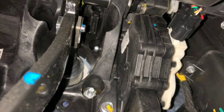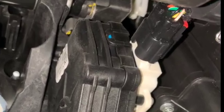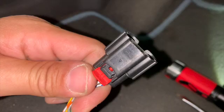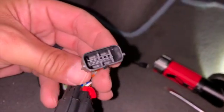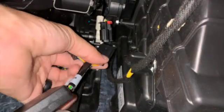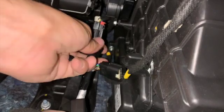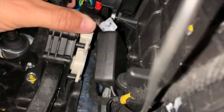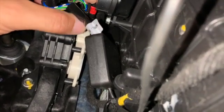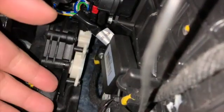Attached to the Go Pedal, you want to locate the car's throttle position sensor and its connection with the red tab and wires coming out of it. To undo the connection, unlock the red tab and push down on the little tab behind it. Gently pull the connection off of the throttle position sensor. Now take the connection from the throttle controller, plug the controller's connection into the input so that you hear the click — it'll only go in one way. If it doesn't click, you might have it backwards. Once you've double and triple checked that it is secure, next install the controller's connection to the throttle position sensor of the pedal. Lock it down with the red tab and make sure it is completely in there. Double and triple check those connections and then you can use some zip ties to keep the controller box out of the way of your foot.